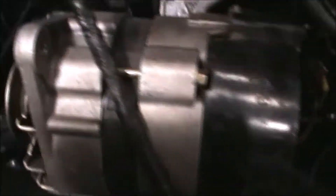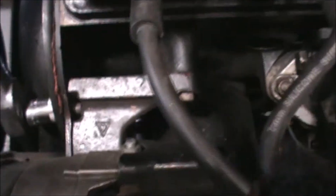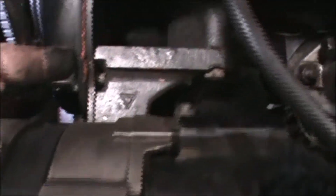Here's a view of the alternator from the top. I got the nut off the bolt, but I can't get the bolt out of the casing because this is not a factory electric fan, and the bolt runs right into the fan. So my only option now — which probably would have been a good idea anyway — is to unbolt the alternator mount from the engine block.